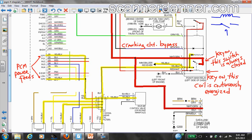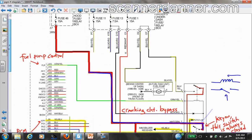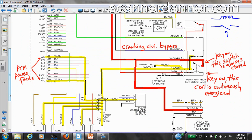Where does this power come from? It comes from the highlighted red wire, which is hot all the time. That red wire goes to a fuse in the underhood fuse box — a constant 12-volt feed going to this part of the relay. That doesn't mean our yellow circuit has power all the time; it just means the supply on the red wire is always there, and once this switch closes, we power up the yellow circuit.